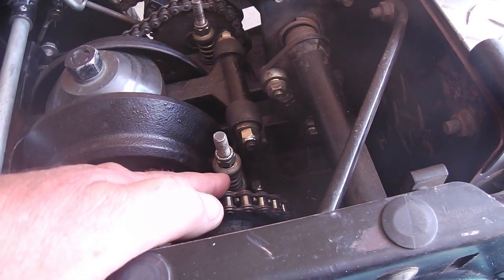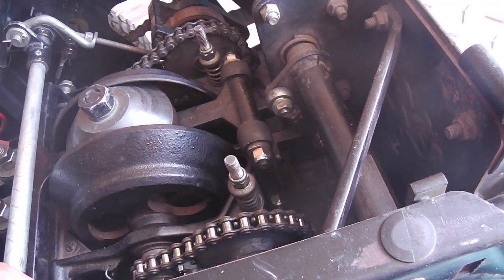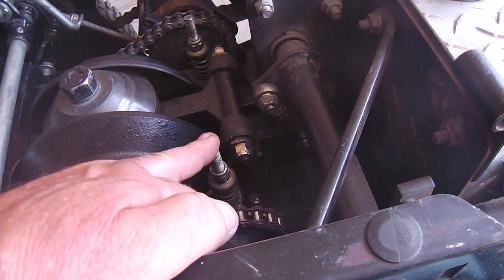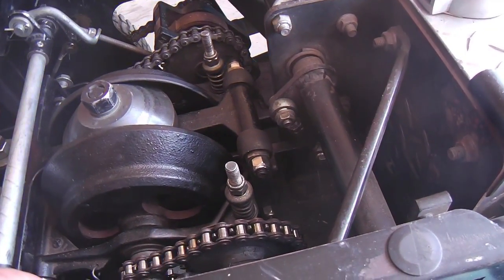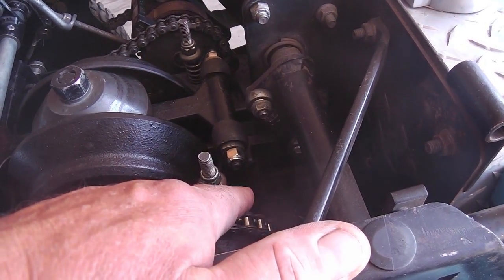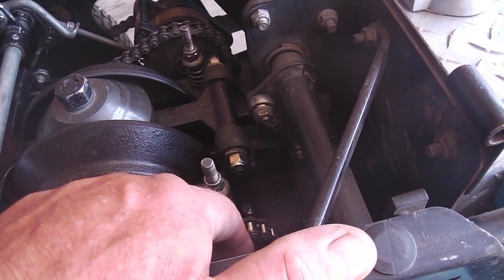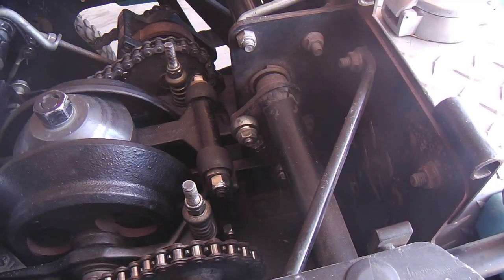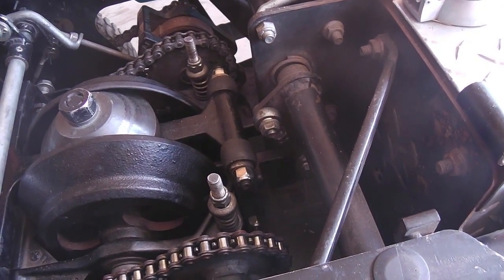In the literature on this neutral spring rod, it'll tell you to drive it down below the base, and I said just leave it flush, because on the bench it makes it a lot easier that way. There's no real need for it to be driven beyond flush underneath. That just makes it difficult to rest on a bench for all the adjustments. And all that really does, there's two holes down here in the mounting chassis, and those two nubs hanging out, it just sets it up for the alignment for the other bolts to go in. It's needless. It's over-engineered. It was a nice thought, but it just gets in the way.